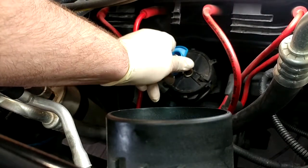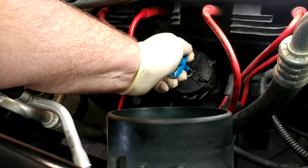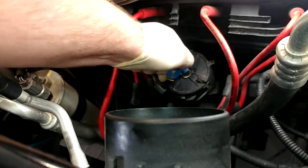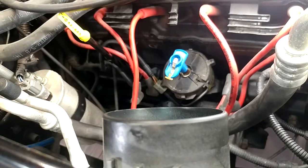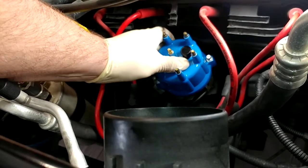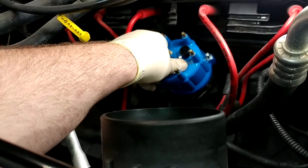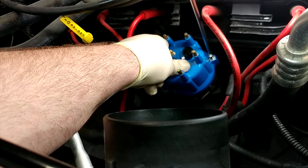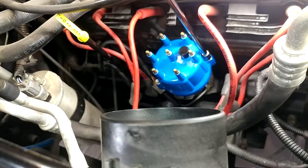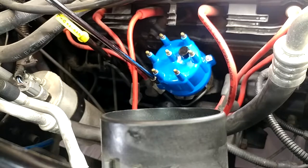Get our new rotor slipped on — we absolutely do not want to grease any part of the contacts. He fits, about the same as the old one, maybe a little tighter. Get our new cap on so the number one is pointed in the same way the old one was. Make sure it wants to sit kind of natural-like, which it seems to. It'll be a little spring-loaded because the rotor is actually pushing up on it. Nice affirmative lockdown. I've got a screwdriver to get the bolts started, then take our ratchet and give them just a little bit of torque. You can totally crack a cap doing this, so take it easy and work side to side — don't be a monster.